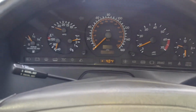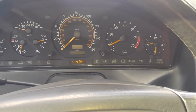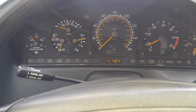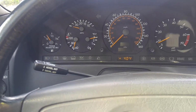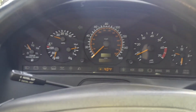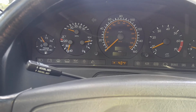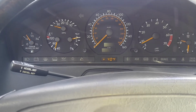It's really annoying when you accelerate hard, it just pops up. From what I see, on the left rear the roll bar trigger sensor is much closer to the lower control arm than on the right side. I don't know what happened, but that is what I see with that activation. The car squats when you accelerate hard, and it triggers the sensor because it's literally this far away. I have no idea why it happened, and I'm not looking into it right now. First, the major focus is on the engine and transmission.